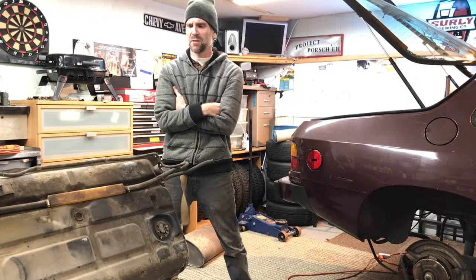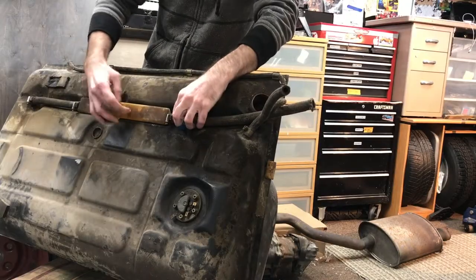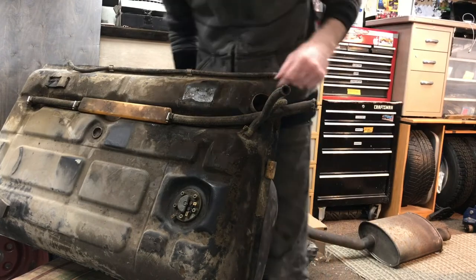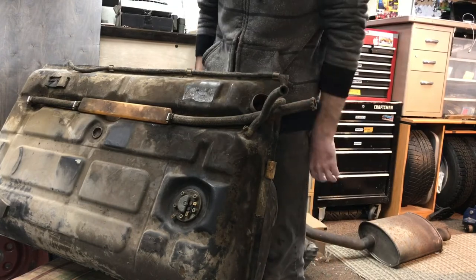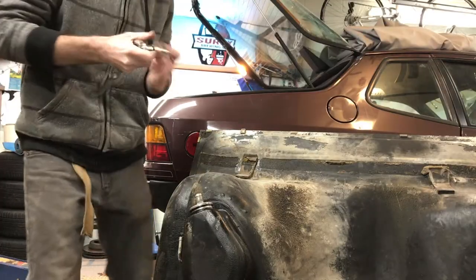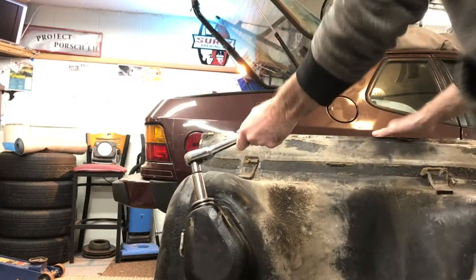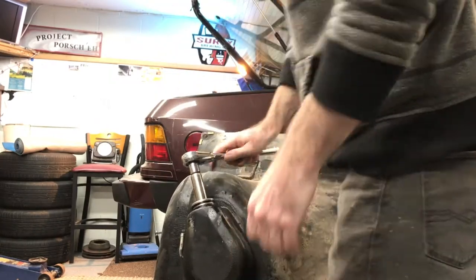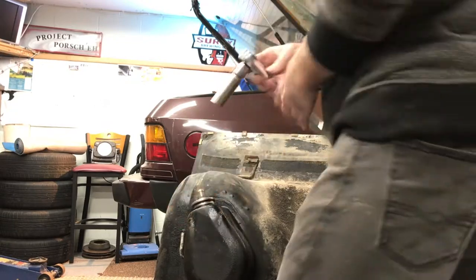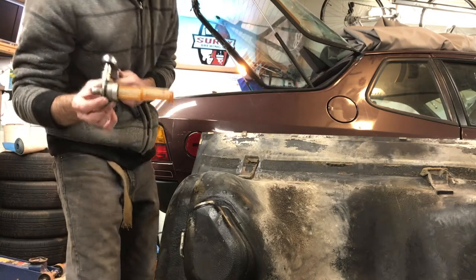The tank looks really good. I think it's just leaking when you fill it up tall. This looks good. The fuel hoses were so corroded, the fuel just sort of leaked out all around them and left that darker area on top of the tank. 17 fits over this thing. Besides leaking out of the fuel level sending unit and the corroded hoses on top there, everything else looked good, so I could concentrate on cleaning it up and resealing it.